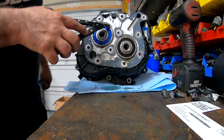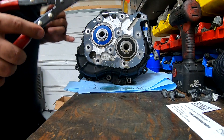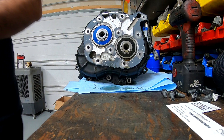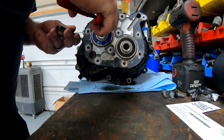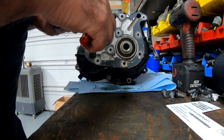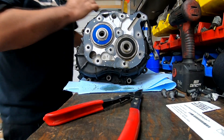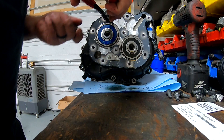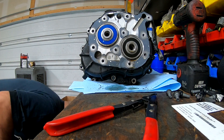Now that we have the plate off, you have two snap rings on the back. You can get these pliers at O'Reilly's for like 20 bucks. What you're going to do is hold it on the bottom, maybe with a screwdriver to make it a little easier, and then hit it with the pliers and pull the ring out. Also, what you can do is move the shaft back - you get way more room. Push it back, it makes it easier to get the pliers and grab better. Pull it out and be careful.